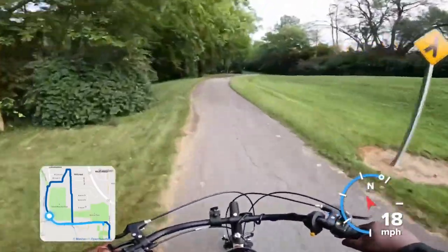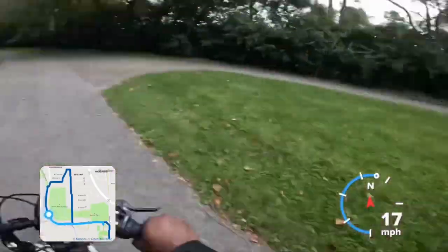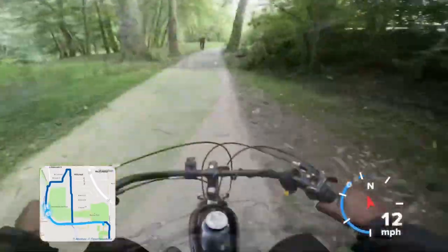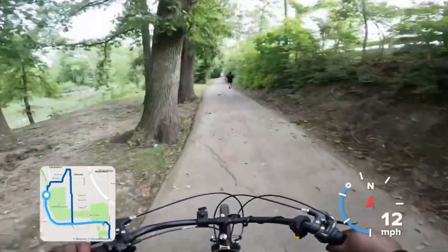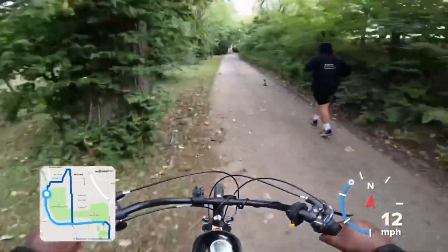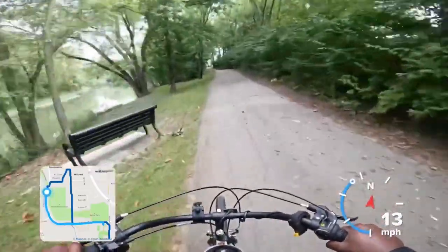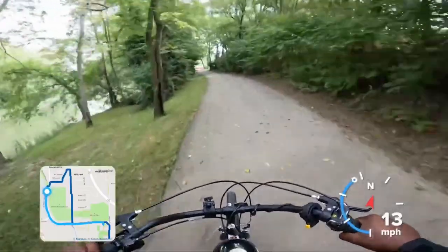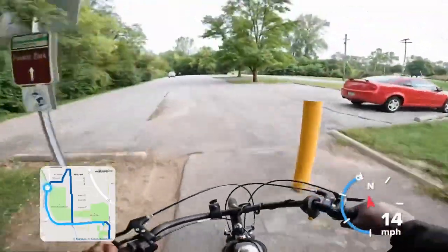And lastly, on the Huffy Lachlan, and any other bike that has aluminum wheels with rim brakes, keep a close eye on your rims. The aluminum's a softer metal, and it doesn't last nearly as long, especially on motorized bikes. Little bits of rock and sand that gets embedded into the rubber of your brake pads will chew away at the aluminum over time. And never let the brake pads get down to bare metal. You gotta stay on top of that, because it'll near instantly destroy your rims.